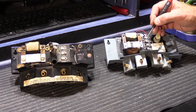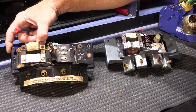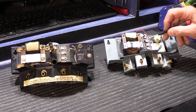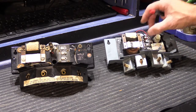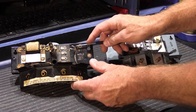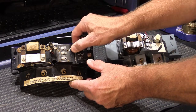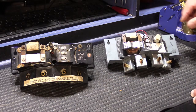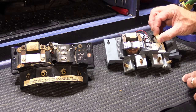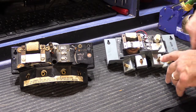Each chime base has an eight and four note switch. On the K model chime it's a lever switch mounted at the top of the chassis above the Telechron motor. On the L model it's a little slide switch on the plastic base of the motor assembly. On the K model chime there's a fairly elaborate volume control from soft to loud with an off position that turns the chime off altogether. The L model has a rotary potentiometer — there's no off position, but you still have loud to soft and can adjust how hard the plungers strike the tubes.